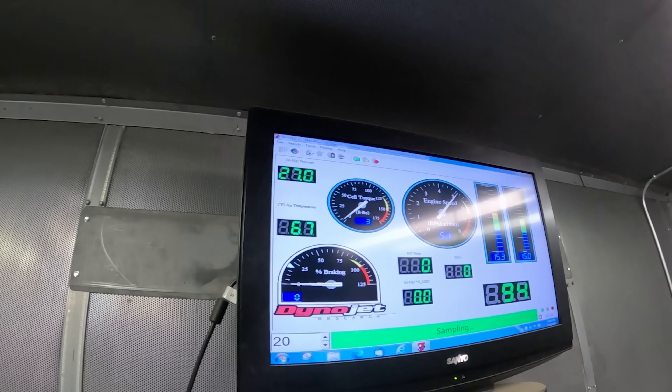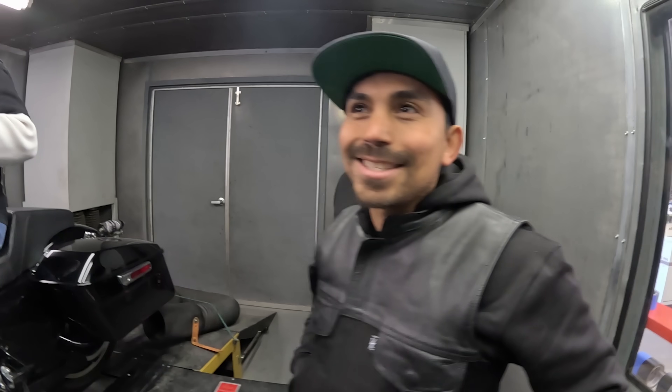It applied all the auto-tune stuff but it's got a couple auto-tune sessions in it. It's the best sounding bike - the cam sounds amazing. So now fourth gear pull. Run one on fifth gear and fourth gear - after 4500 the air-fuel ratio is way too lean, jumping into the 16s. That'll burn a hole in things. It gave us information on what that tune is - it's really fat at idle, part throttle stuff looks a little fat, but everything after 4500 from part throttle to wide open throttle is way too lean. Out on the road you might have been really out of power because it's dangerously lean.